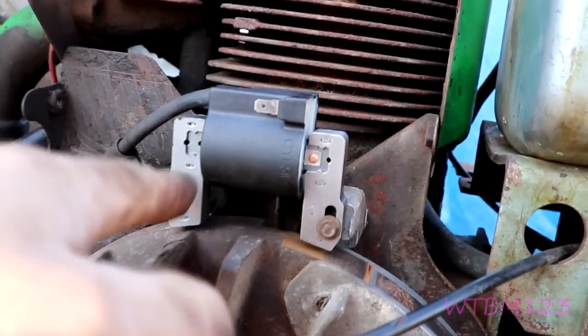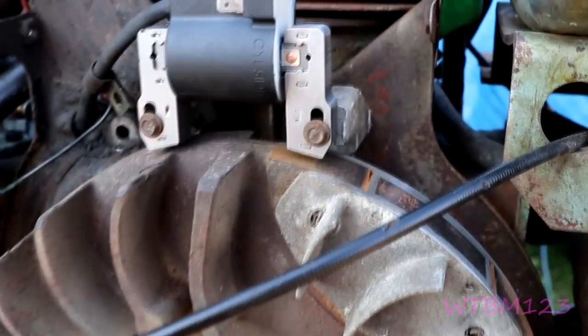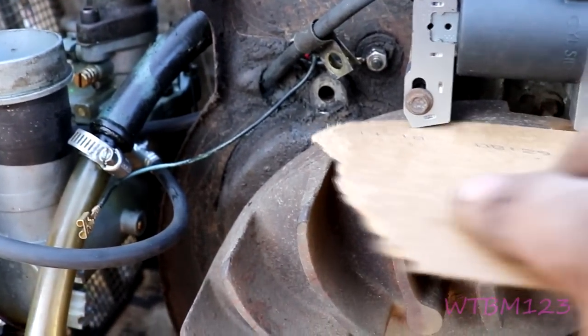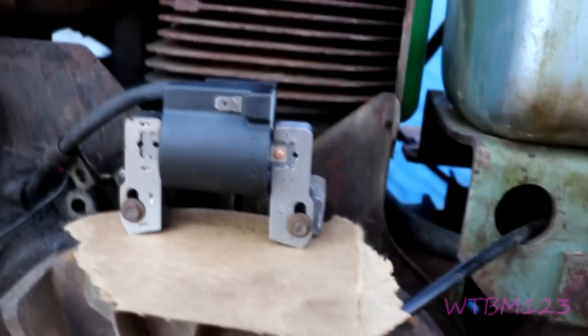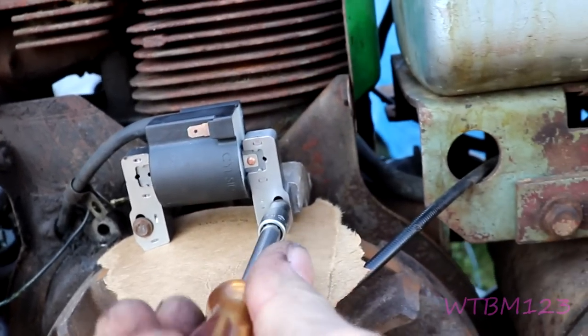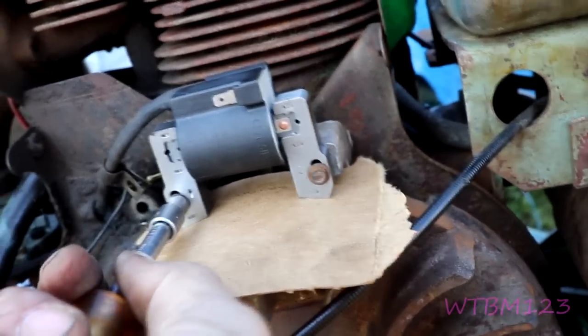I get it up in position and snug it down — 10 to 14 thousandths, you can go to about 12 thousandths. Put one feeler gauge under each leg. Here's what I do a lot of times: see this magnet on the flywheel — you put the coil up underneath the magnet and then when you loosen it, it'll suck right down to the magnet. Then you can tighten it back up. Let's do that and see what gap we get. I know you're supposed to set it with a feeler gauge, but a lot of times...